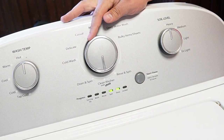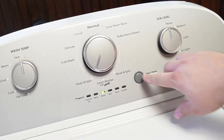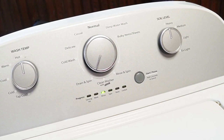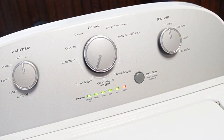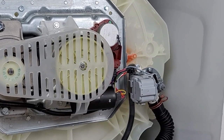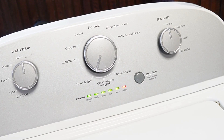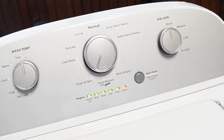Once you're in this mode, turn the knob clockwise four times — the rinse light should be the only one illuminated solidly. This is the recalibration mode. Once you press the start button, the door lid will lock and it will begin a series of tests and operations. All these tests take approximately three minutes to run all the way through. As the recalibration mode runs, every part and process on this washing machine is going to be run and the machine will physically reset all the components to a default state, allowing them to run at an optimal level — a must when parts aren't working right or you've replaced the shift actuator or a control board. You're going to hear all kinds of noises from the machine, and that's totally normal. When the calibration mode ends, every single light will turn off, including the lid lock light, and the machine is now recalibrated for use at an optimal level.